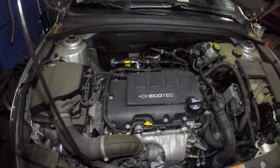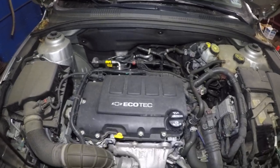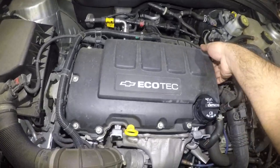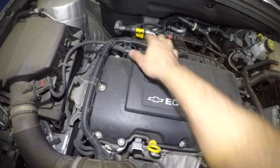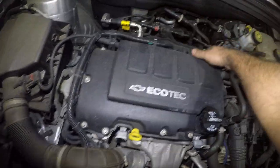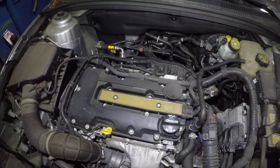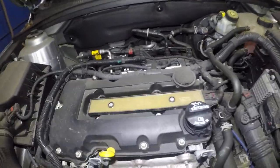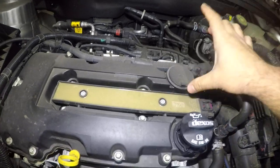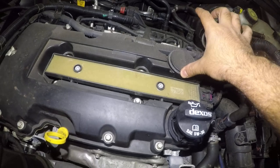But if your car is making a whistling sound like 'zzzz' and it's really noisy, pretty much what happened was your PCV valve in here. I did this job years back and I noticed if you put your finger right here when the car is running, if you hear a noise like a whistling sound and you put your finger right here, the noise is going to go away.